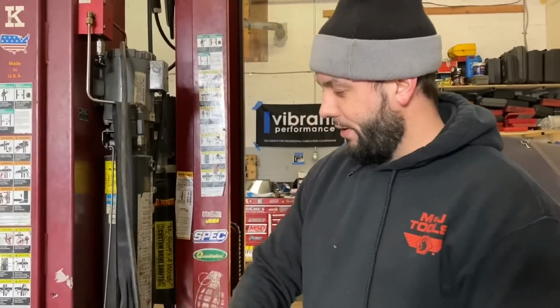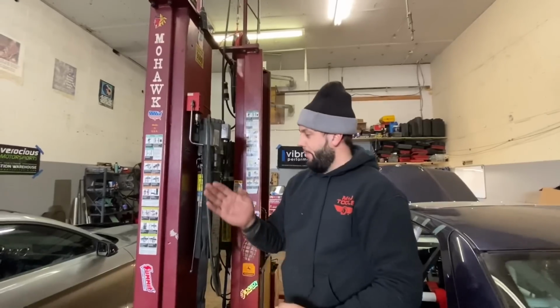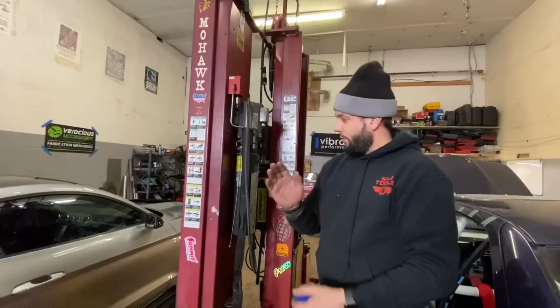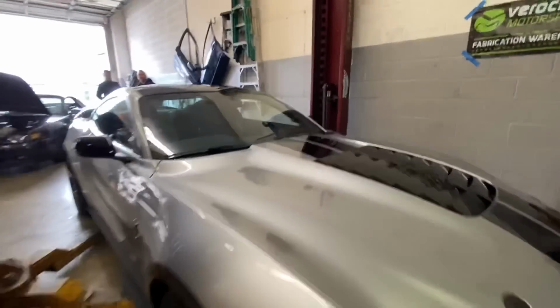Yeah, we built complete custom manifolds to the catback system, stage one, so that customers can keep the catback with the four mode exhaust positions. And it's a modified X pipe. You'll see it's a little bit better than the 90 degrees that Ford used. And we have no converters, all that good stuff. Oh, converters are gone. Cast, right? Yeah. All right, let's see what it looks like.